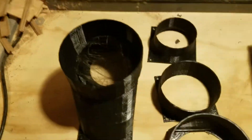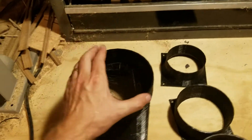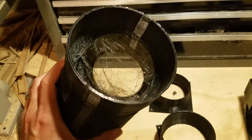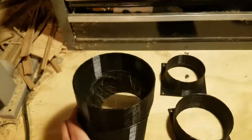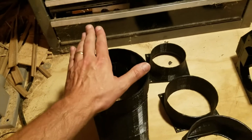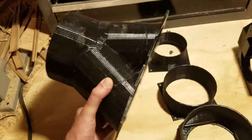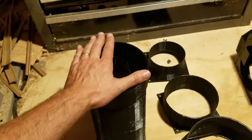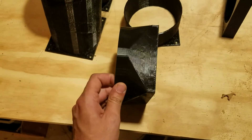The dual was initially designed as a four-inch dual about a year ago and it worked pretty well with the S7s. The problems came with the S9 — you had to add an inline fan with the four-inch version to really get that draw so you didn't run into melting problems or over-temperature on the Antminer. This one's fresh off the printer for a customer. With the six-inch version I'd still recommend using an inline fan, because most of the time guys are putting almost 25 feet of HVAC line on here, and those Antminer fans are not going to push that much CFM down a 25-foot six-inch hose.